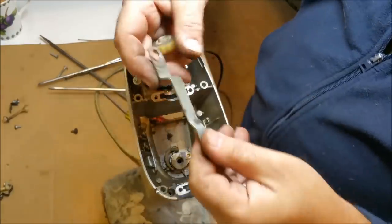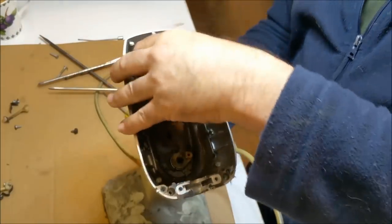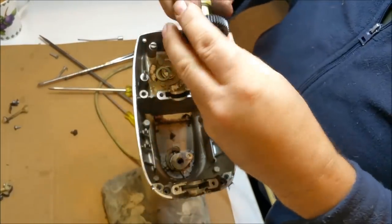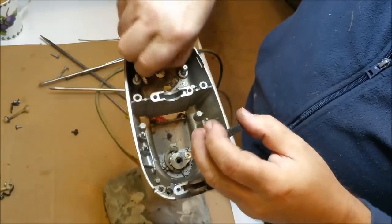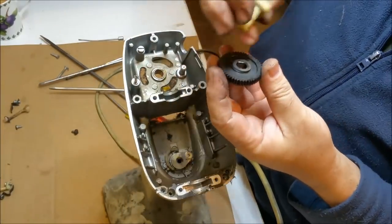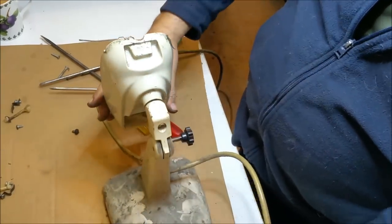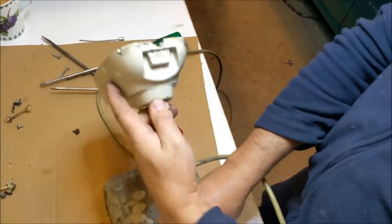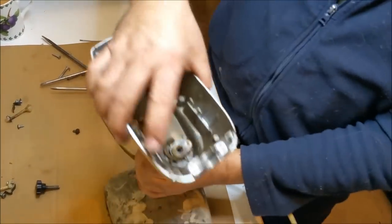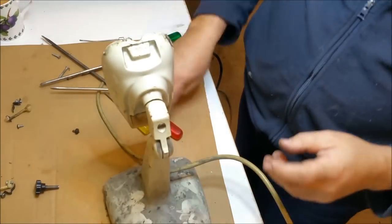This is where we're just blindly pulling crap off. And then that guy, oops, should come out, which it kind of does. And there's a shim in there as well, as well as a sintered bronze bush, which is what that looks like there, which is pretty cool. So we'll just take that little tightening screw out. That should come out, even though I don't think it's going to, because there's still a roll pin in there, but there is a screw in the bottom.